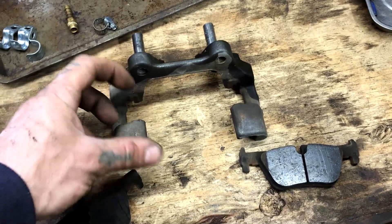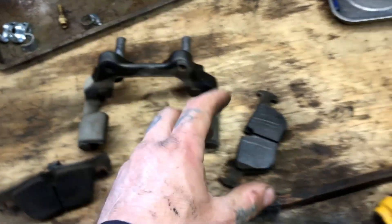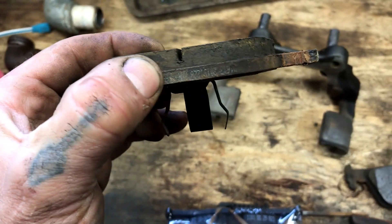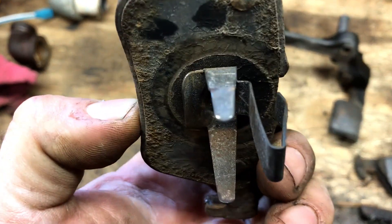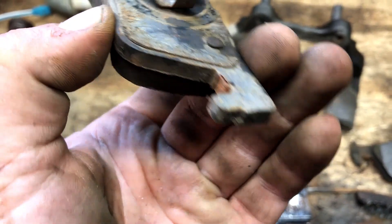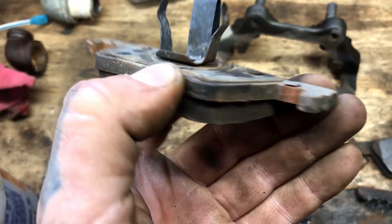The point of the video - my pads are good, but I would have to clean them up. You can see where they're rusty - that's where you'd want your grease. You can put a little bit where it slips in around that ring where the piston goes. On the outer edges, you can see it doesn't even rub - so why put any lube there? It's just gonna fly off. These pads even though the rotors are wrong, these pads do seem to be correct.